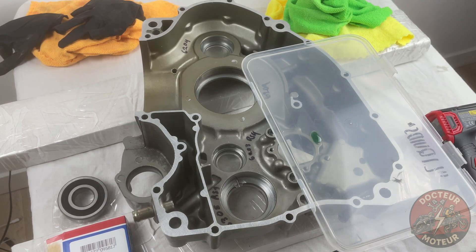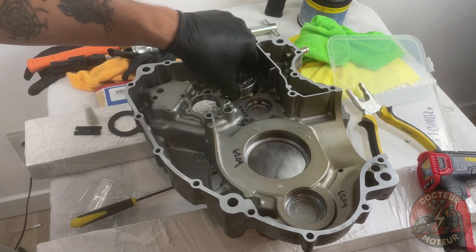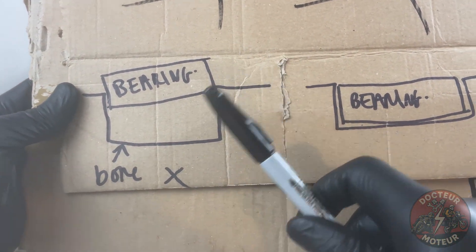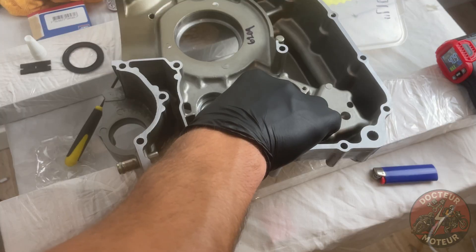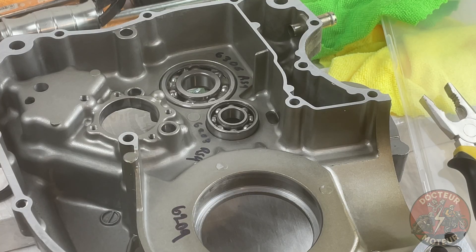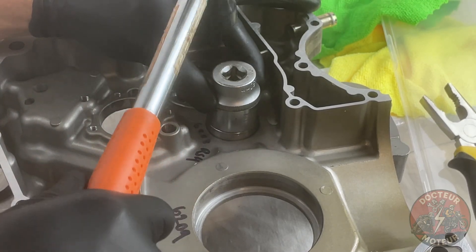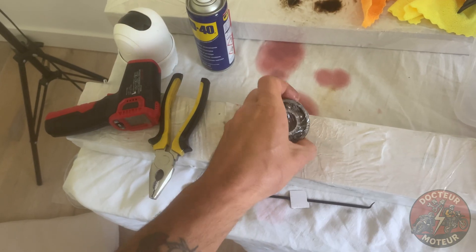The next step is time critical — you have around 30 seconds to drop the bearing in before the aluminium starts shrinking again. The bearing should drop in no problem; that clink sound is the sound we want to hear as it gives a good indication the bearing has completely seated. The key is to have the bearing fall in flush — we don't want to risk jamming it down unevenly. If the bearing still doesn't seat completely on its first try, have the appropriate socket matching the bearing's outer race and a hammer ready. Gently tap on the socket to square the bearing off. Whatever you do, do not touch the inner race — this will damage the bearing.